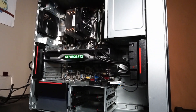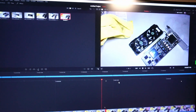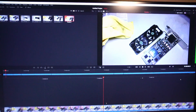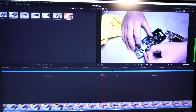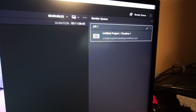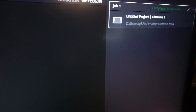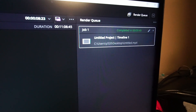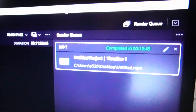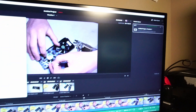The system is looking great. I've got DaVinci Resolve 18.6 loaded up with my usual 11 minutes of raw 1080p footage. Using DaVinci Resolve with this hardware works very well, but what I'm really interested in is how it compares to the 4-core 8-thread Xeon for rendering. It looks like we're accessing those boost clock speeds on the CPU. The render completed in 9 minutes and 49 seconds, compared to 13 minutes and 45 seconds with the 4-core 8-thread Xeon — a 4-minute difference.